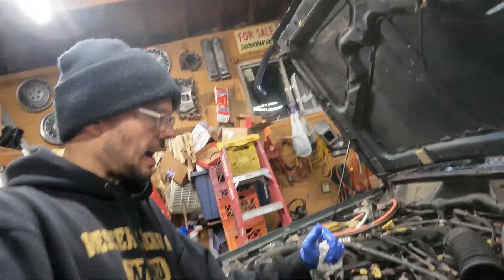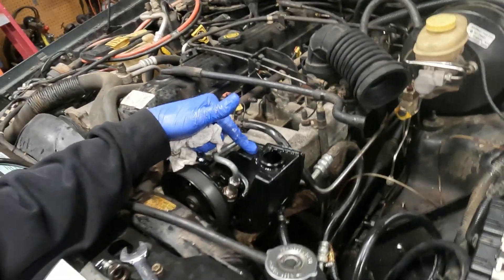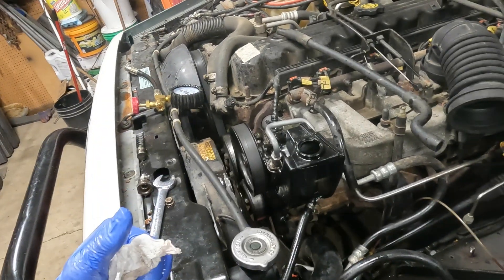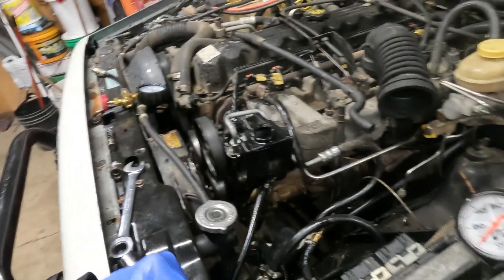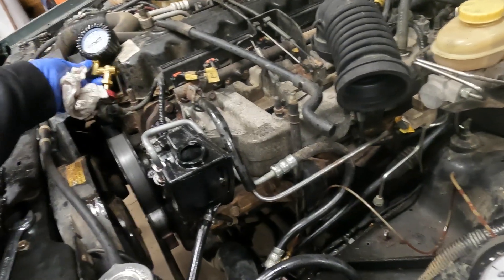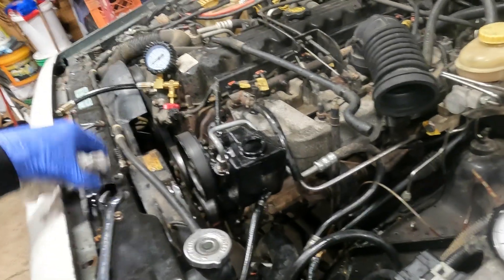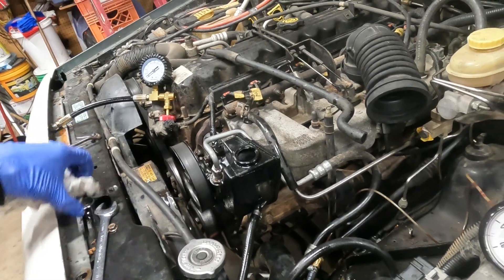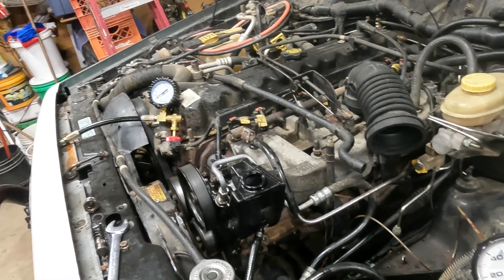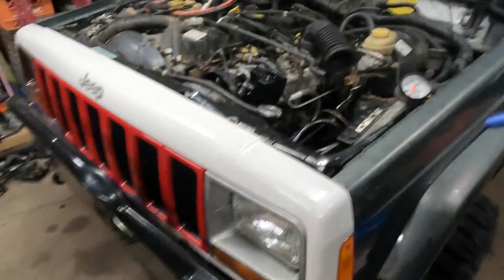I'm making this video about a WJ pump swap. I had issues with the WJ pump swap - I drilled out the fitting and it was blowing the cooler lines off. I wanted to take the scientific approach and put some pressure gauges on here to see: do you really need to swap the whole pump, or can we just swap some pieces and parts of the pump to yield similar results?